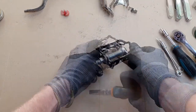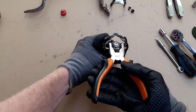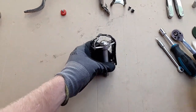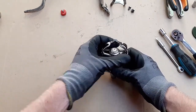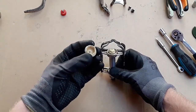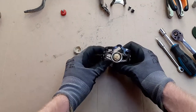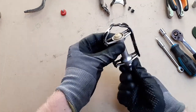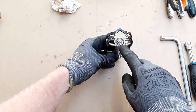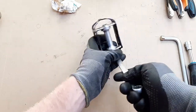To get to the internals of this pedal I've got to gently unscrew the plastic end cap. A set of pliers can help loosen it. The end cap reveals the end of the pedal spindle and lots of original grease that I'll wipe away to get to the lock nut and outer cone. With some grease removed you can see the lock nut, cone and the first set of ball bearings.